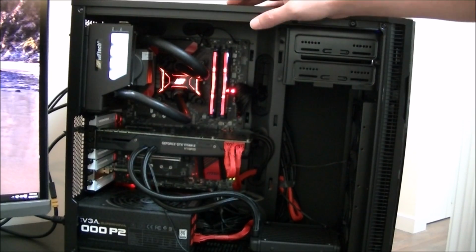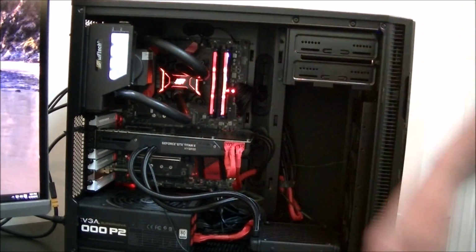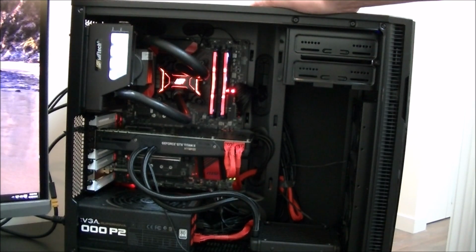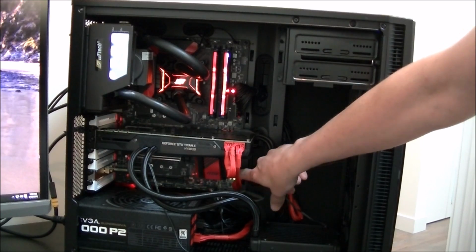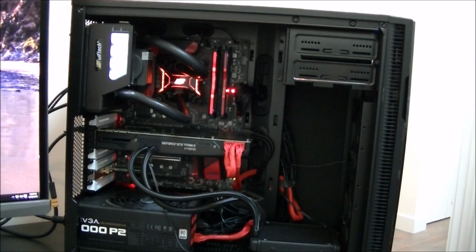It comes included with the big fan and radiator, which you can't really see, but it keeps this thing so cool. It's amazing. I overclocked from the base 4 gigahertz to 4.5 gigahertz, running on 1.34 volts, and it runs probably under heavy load at like 62 Celsius, which this little thing down here can show you. Not sure why it's actually so warm right now, but anyway,